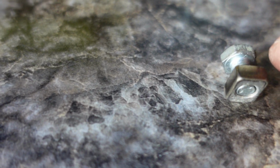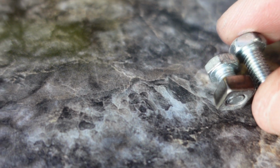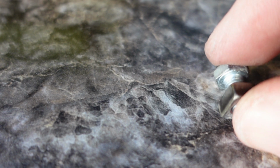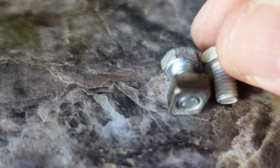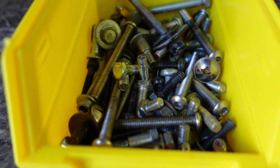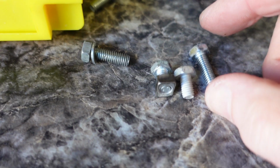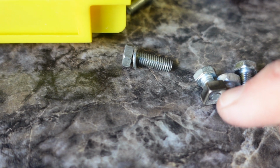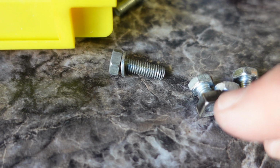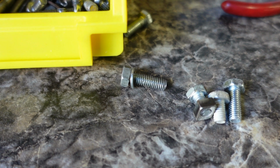Now, because Najat has a whole bunch of extra things on this bike, accessories, you need a longer bolt because this bolt is riding higher and higher up away from the nut. And so you're not catching it. I'm trying to make something simple here. Luckily we have plenty of extra bolts that are just a little bit longer that I have for other things. And in the worst of all worlds, if you can't catch that bolt, again, you can put a toothpick or something underneath the nut, because that nut always has a little bit of play in it. That's just basic 101 information, nothing high-tech there.